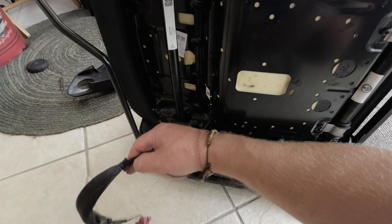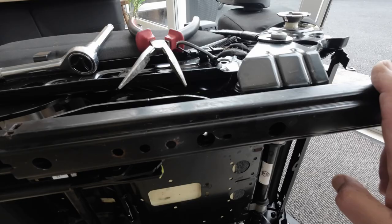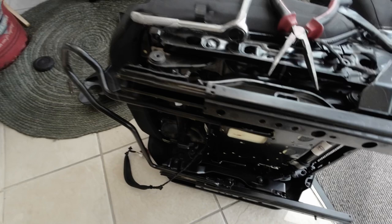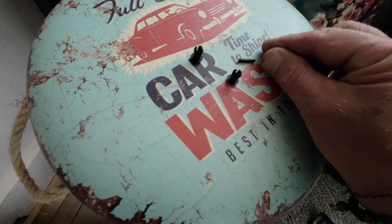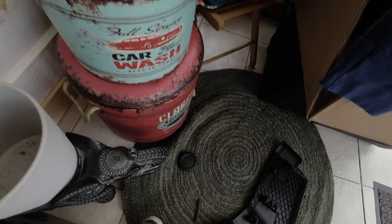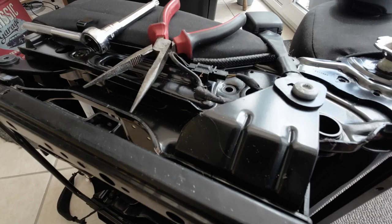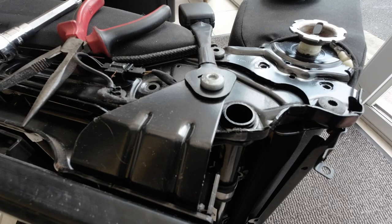The electrics I was looking at is actually the seat belt warning light. It comes around the bottom of the seat to the loom that plugs back into the van. To remove that I had to take this panel off. If you need to take this panel off, at the back you've got two little clips on both sides. You push the center through and you have a pin - that's how it works. Just use a drift, push the center, and it unclips and comes right off.